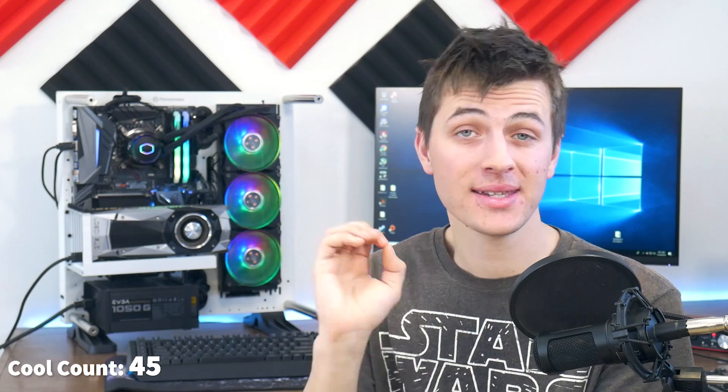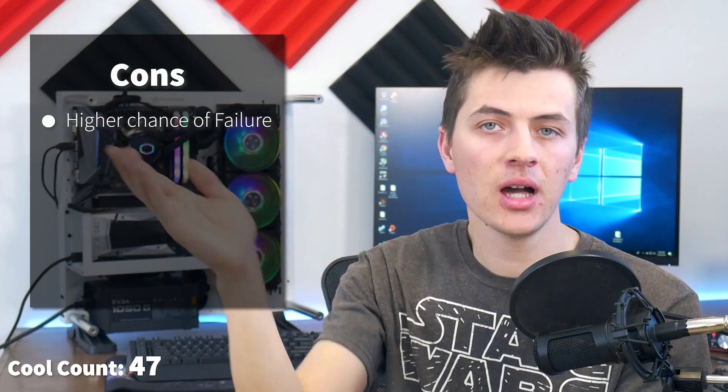Also be aware that, while it's 99.9% not going to happen, there's always that tiny chance of a leak. I've personally never had a leak, and Cooler Master has gotten very good at keeping their systems tight. But if your PC isn't a centerpiece on your desk, you're not interested in overclocking, and you're just going to put your system under a desk where you can't monitor it, I'd say don't bother with an all-in-one — it's more expensive and carries that small leak risk.